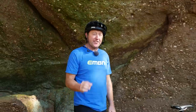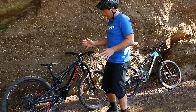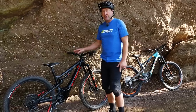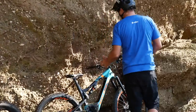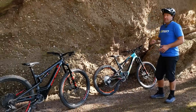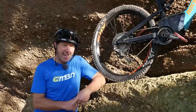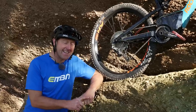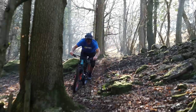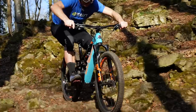Let's look at the numbers — the angles on these bikes give them different temperaments on the trail. These bikes have different amounts of travel. The Instinct has 140mm rear and 140mm front, whereas the Altitude is 150mm rear and 160mm front. In terms of general angles, they're very up-to-date and very much performance mountain bikes. The chainstay on the 150/160 Altitude is actually one of the shortest on the market, and paired with a low bottom bracket height, it snaps into arcing corners — it's got an all-action downhill cornering style, and it really barks when you're descending on rock and root.